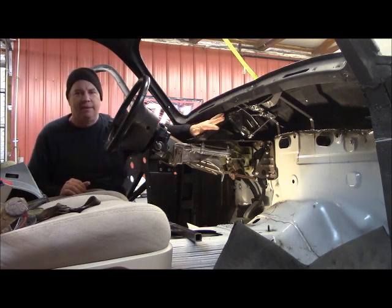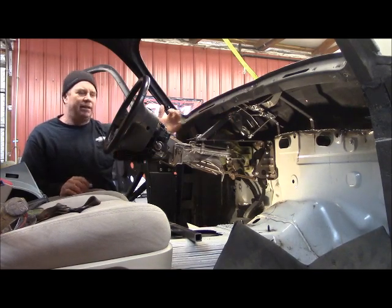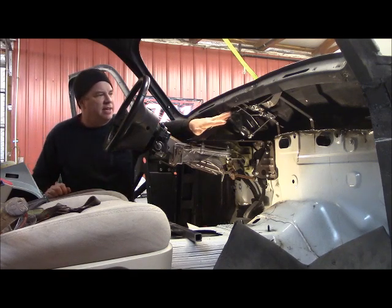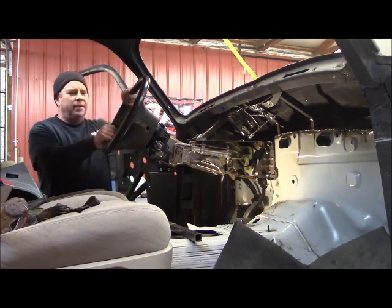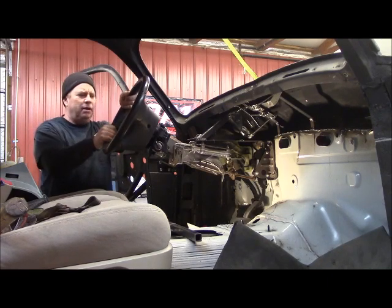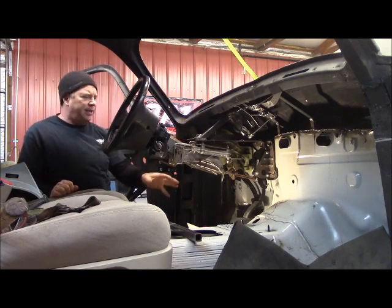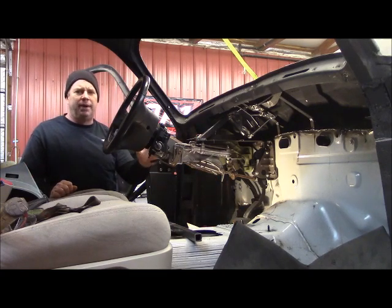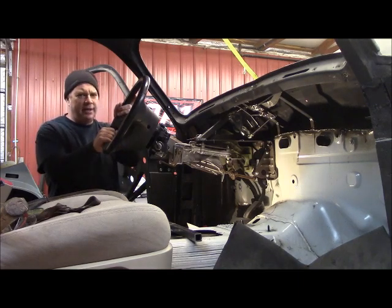Once I decided what I wanted to do right here, I had to come back. Everything in this dash is tied together and has a purpose. To locate all this, I have to start designing a structure to hold this column out so far. There's a lot of length out here and a lot of weight when you pull in and out and move around the seat — you pull on this a lot. So I have to build a frame underneath your dash to support that. Originally it came out of the floor and had a little bracket on the bottom of this dash, but all this stuff's been rusted and moved and softened. There's just no way that's going to hold this.